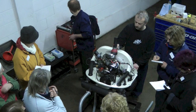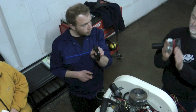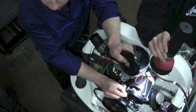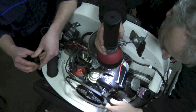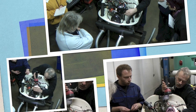If the fan belt — obviously you can see it's kind of V-shaped. When the two halves are together, they meet like that. So if the fan belt's running higher up in the V, it's tighter than when it's running at the bottom of the V. And you space the pulley apart with the shims to set your tension. If we put this back on without the fan belt in — now imagine you're the fan belt sitting in that V. If the two halves come further apart, that's going to make the belt looser because the belt's going to go down inside the groove, because it's wider.